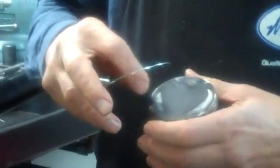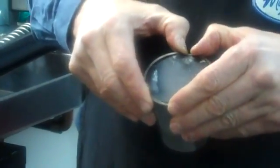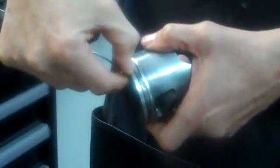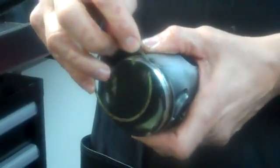People think that they need special tools or something to put these on, or they're afraid they'll spread them and break them, but all you've got to do is just kind of wind it in there. These have got a pin right here — a locating pin that keeps the ring from rotating. On a two-stroke, the ring is not allowed to rotate or it will catch and break. So you just start it where that pin is, stick the ring in, and then just feed it around. It just drops right in the groove.